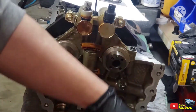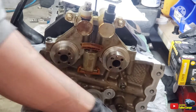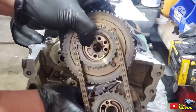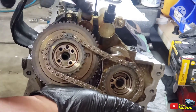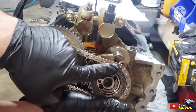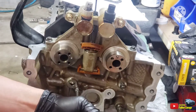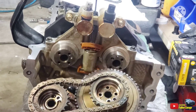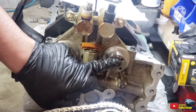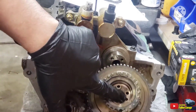So I'm gonna just line up the chain and show you guys how this thing looks. Basically it's like that — there you go. The notch right there with that colored link, and then the R with that colored link. It goes like this — slap it in like that. And you can tell that our pin right there matches up with the hole right there.